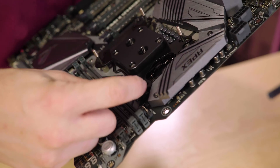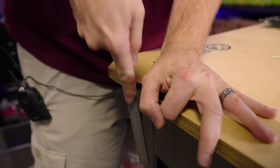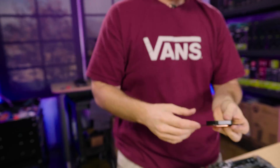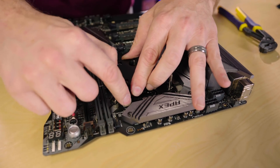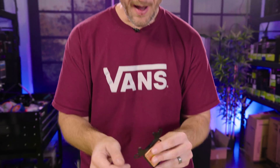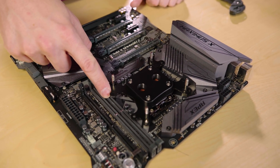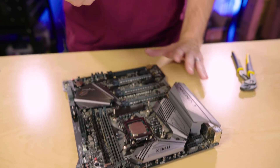Once the posts are in place, it centers itself but is impacting the heat sink by maybe half a millimeter. I could use a file and make it fit, no problem. Also worth noting: if you turn the block this way, the tabs overhang onto the memory sticks. So just expect that an all-in-one fit like this is going to require some level of modification depending on your board.